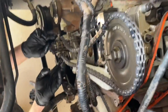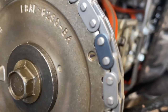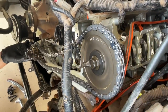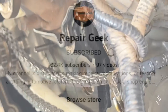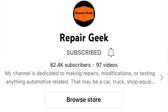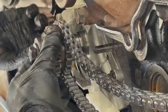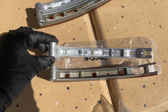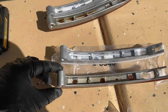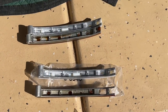Make sure that the link is at the dot down at the bottom of the crank, and also that it's at the top here lining back up dot to dot. I found it easiest to put the chain on at the bottom of the crank and then up on the underside of the cam gear. As we put on the driver's side tensioner, we're going to pull the crank sprocket out a little bit - this is a tip that Repair Geek made; he had some really good videos on this as well, so check out his channel. By pulling that gear out a little bit, we'll be able to get the new tensioner in there and do it with the tensioner arm. Remember, left refers to the driver's side as if you're sitting in the vehicle. Make sure you have the correct tensioners - see how this one's a little bit longer up here at the top? That's the passenger's side one. So they are a bit different - make sure you get the right ones on the right side.